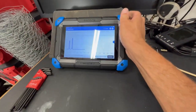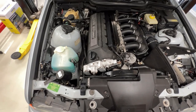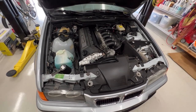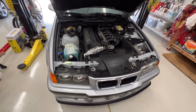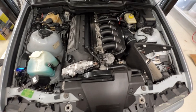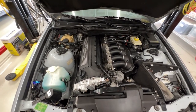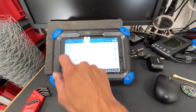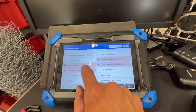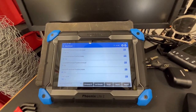So I think, if anything, I did have this Vanos overhauled by Dr. Vanos, and it hasn't gotten a lot of miles since I did that overhaul. In retrospect, it's been a long time, but it hasn't had a lot of miles put on it since. I know O-rings, the oil can make them brittle and all that, so maybe that camshaft sensor, the actual position of the camshafts, or maybe this is a big deal. 1.2 degrees off, 1.1 degrees off.